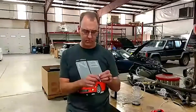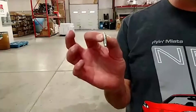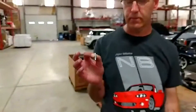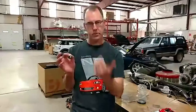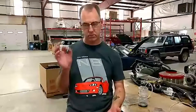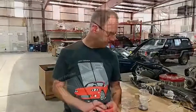This little guy looks a heck of a lot like a regular brake bleeder, but inside there's a check valve. So when you press on the brake pedal and the valve is open, it allows fluid to come out, but when you let off the brake pedal, the check valve closes so that air can't get back into your system. So the strategy is: open the valve, get in the car, and pump away at the brakes, and you'll bleed all the air out of the system, and then close it, and you're done.